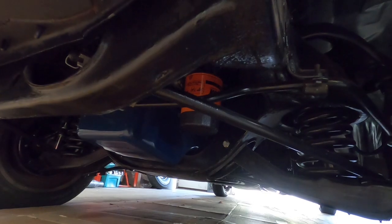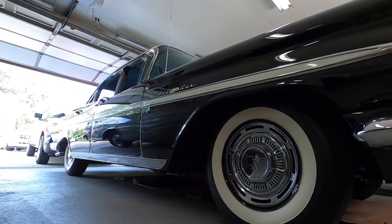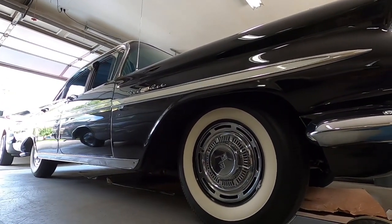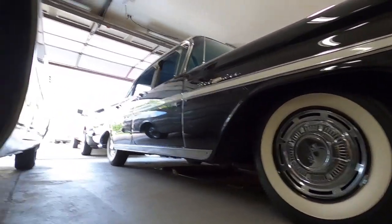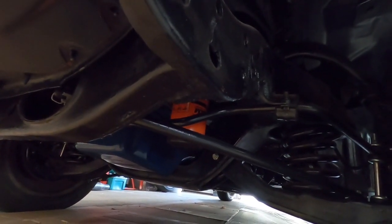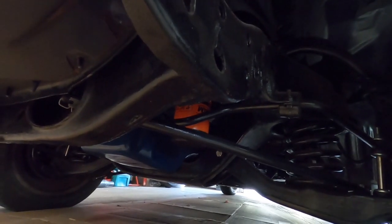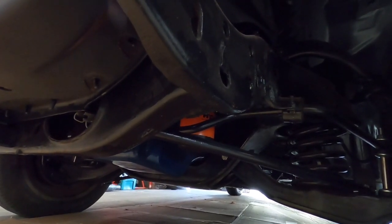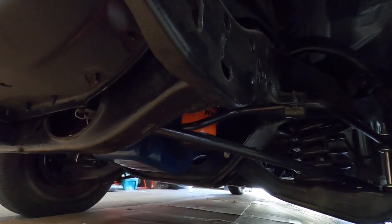You know, I'll probably change the oil in this once a year. And that's how often I do it in that car for the amount of miles I put on it. This year I don't even think it'll have 1,000 miles on the oil when I change it, but I always change the oil in them in the fall, so when they sit over the winter they have clean oil in them, so you don't have any contaminants in the oil that can damage the bearings or cam lobes or any surfaces in the engine. I always make sure I have spotlessly clean oil for winter storage.